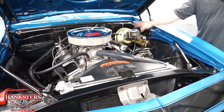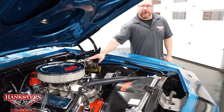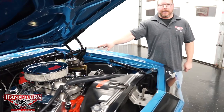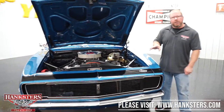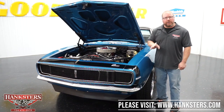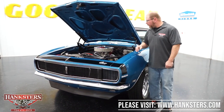It's got aluminum pulleys, power brakes, and power steering. The brakes on this car are front disc and rear drums. Behind this engine, you've got the transmission — it is a Power Glide automatic transmission. And then to complete the driveline, you have a 10-bolt GM rear end, the big 10-bolt tube with the 8½-inch ring gear, so a good sturdy rear end underneath this car.